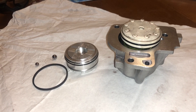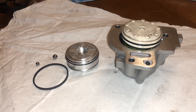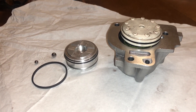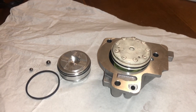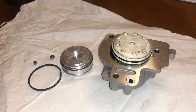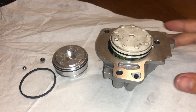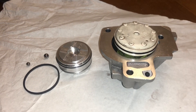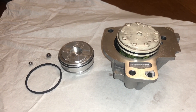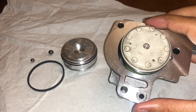What's going on guys, this is Frank. Today we're working on a 1-2 piston accumulator on a 4L60E. My model is a 2003, but if you have a '94 and up this will apply. First things first, you're gonna have to drop your transmission pan and remove this accumulator housing, which is just three bolts — pretty easy to do. They're 10 millimeters, so you remove those three and pull it out.